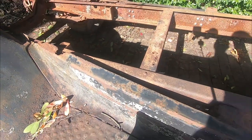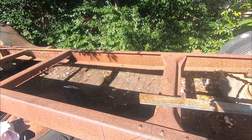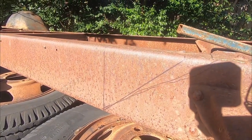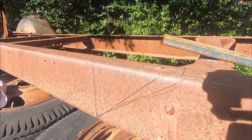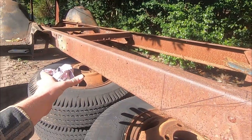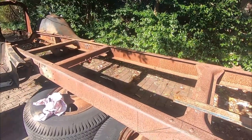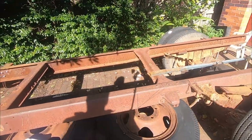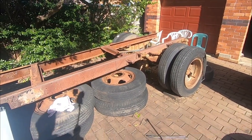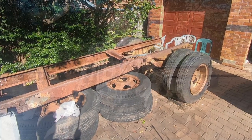we're going to need to cut the middle section out of our 36, and we need to cut it along this 45 degree angle like we've marked on this Dodge, the 35. Now the 35 will also be cut here as well, and the entire chassis will be flipped around on the 36, which will now give us a total of an extra 200 mil wheelbase that we can gain, as well as our 200 mil off the back end, which is exactly what we wanted.